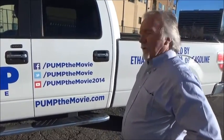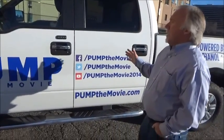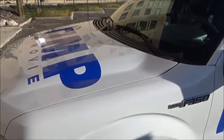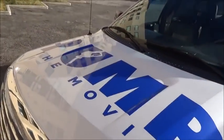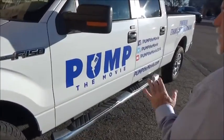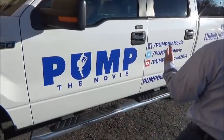We went about testing this and running it on gasoline, doing some baseline testing, but then I switched to E85. Around here in Utah, our E85 really is E70. The distributors of the ethanol told me it's always E70 here in Utah, which is typically a winter blend of ethanol. I had no problems at all running this truck on either gasoline or E85. After a lot of testing on E85, comparing performance, mileage, and drivability, I found zero issues running between gasoline and E85.